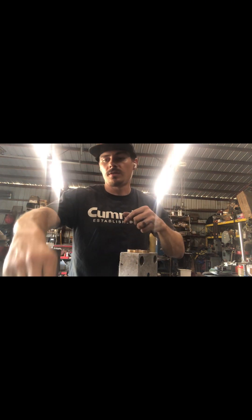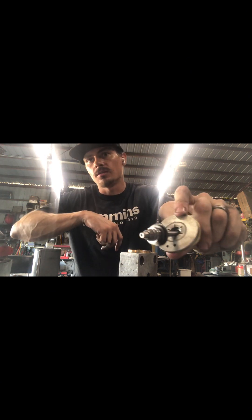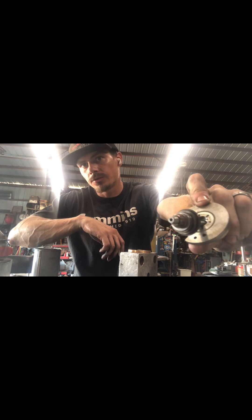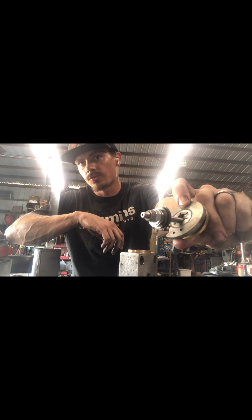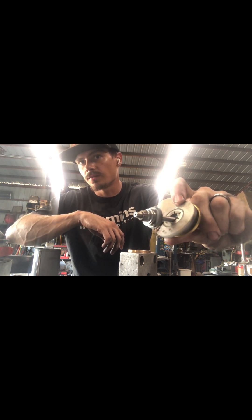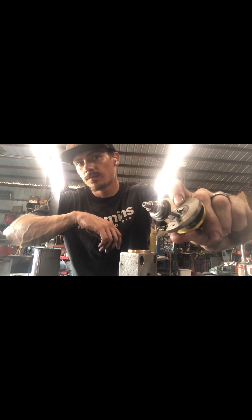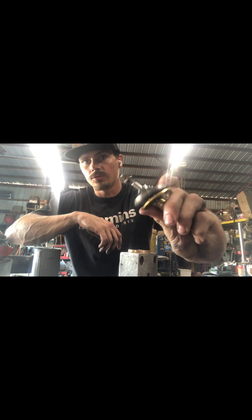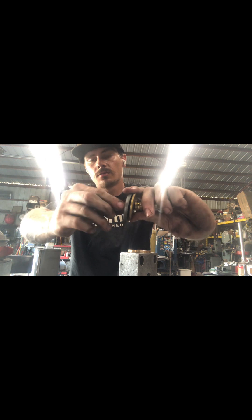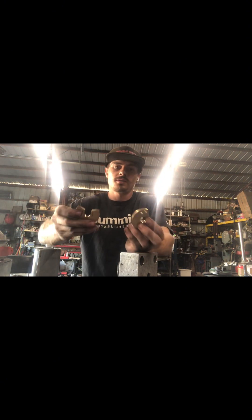If you're curious — can you kill a 360? Yep. Here's the baddest of the bad, here's a 360 steel. This was from on-throttle surge — the turbo going into unsteady state flow to an extreme degree while trying to accelerate, not letting off the throttle. This caused it to break the oil film on the face. The thrust collar, because this is steel, heated up rapidly. You can see the bluing on this guy here — and it killed it quite fast. That's usually the bane of thrust systems.